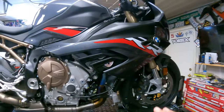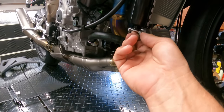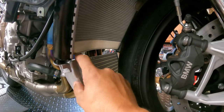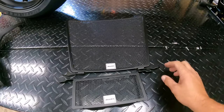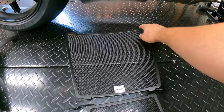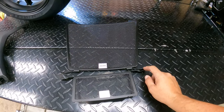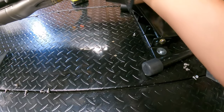Now we have a fully exposed radiator and support. We're going to be removing this screw and the other screw to bring this cooler loose, and then we can slide everything in. The radiator guards mount by sliding into the top bracket up here — they slide in and secure there, and then the bottom piece actually just clips onto the radiator guard.